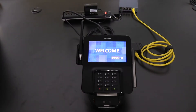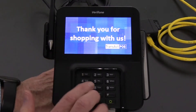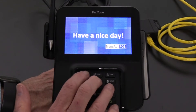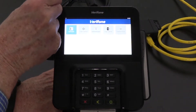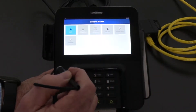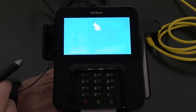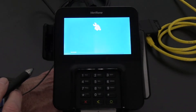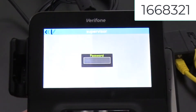Once the system is up and running and has all its updates applied, we can go into the Verifone device by pressing one, five, and nine simultaneously. That will bring up the main menu of the Verifone device. Using the stylus, we're going to choose Control Panel, then choose Sys Mode. Then we're going to choose Supervisor and enter in the password: 1, 6, 6, 8, 3, 2, 1. Then press the green button.